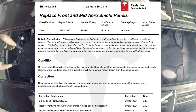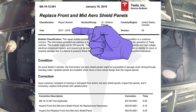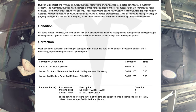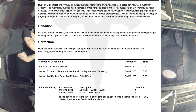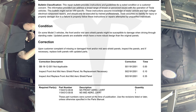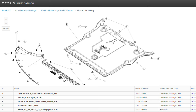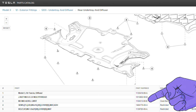While Joe's doing this, I'd like to show you a service bulletin from Tesla published in 2019, covering early Model 3s built in 2017 and 2018 — so this doesn't apply to any UK Model 3 as deliveries started in 2019. What this tells us is that Tesla probably did have a problem with the first revision of the aero cover; maybe it wasn't strong enough, and there were problems when cars were driven through standing water. Importantly, the part fitted today is the same revision B cover specified back in early 2019, which you'll see even in today's catalogue.